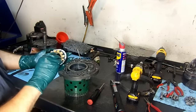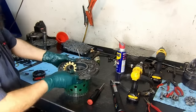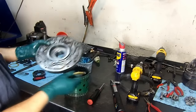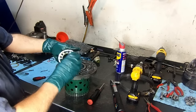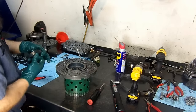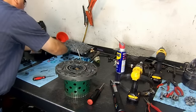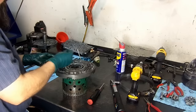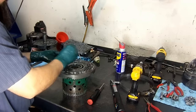Now we're going to put our, they call this a snowflake, but it's a rotor guide that actually centers the rotor. That's why you have this little step here, and this actually centers it. So we install this rotor guide inside the rotor, on the rear of the rotor. We get one of these expander rings, drop it in there, and then drop in our rotor. And now we're going to install 13 vanes, little squares. We already have one expander ring on the bottom, the rotor guide.